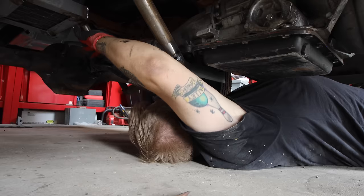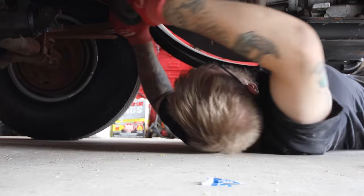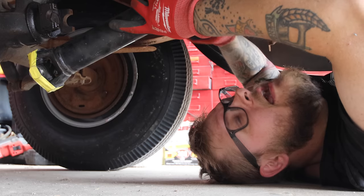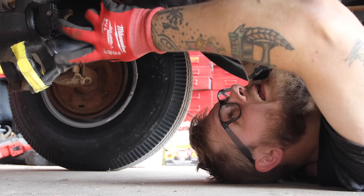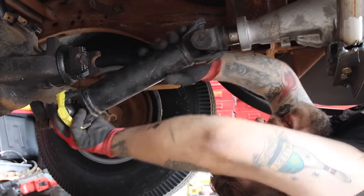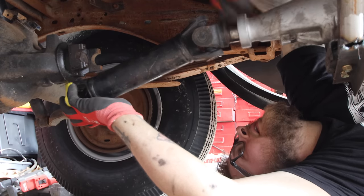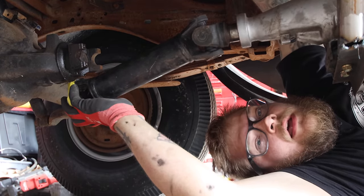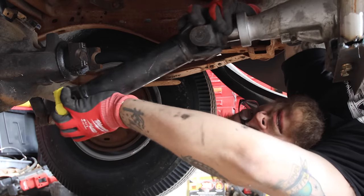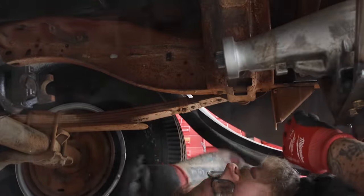When you jack this thing up, the rear end doesn't drop. So if you hit a bump and the back end comes off the ground, it won't pull this into any weirder angle than this. The angle I have this at, I have them both matching at like 3 degrees. And then as that travels, it will take this drive shaft and move it this way. When it does that, it pushes this in and out. He told me to pull it out like an inch, then measure it when the weight is all on it, and then with the limiting straps on it, as it pushes in, it can never go past that 1 inch as it pulls in and out here. See what I'm saying? Yeah. That should be just fine.